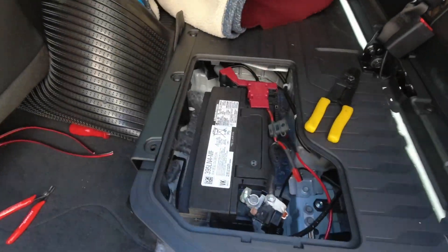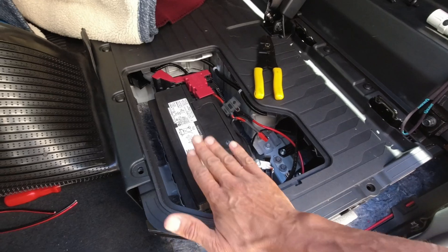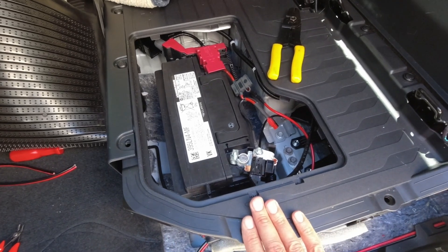There are several ways you can wire dual isolated batteries. In the old days you would just use a relay switch, so when you turn the ignition off the two batteries would be isolated, and when you turn the ignition on they would link together. In my case I can't do it that way because the truck is 12 volts — the starter battery is a lead acid behind the driver's seat, and this is a hybrid version.